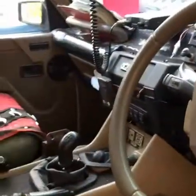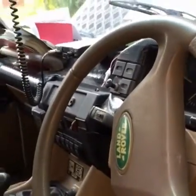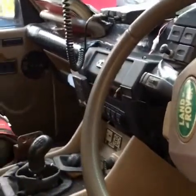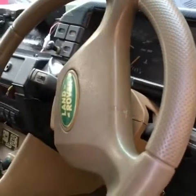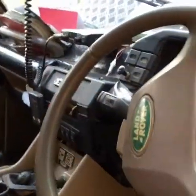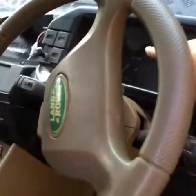Today when I woke up this morning, I wanted to start up the vehicle. I didn't know really what was going on, but every time I was pushing the start button, there was a clicking noise coming from that area over there. So I knew there was power getting here, because the lights were coming up on the dash — there was power coming up to the switch, but it wasn't getting to the starter motor.